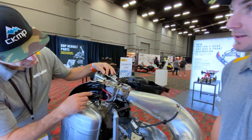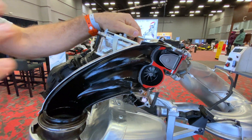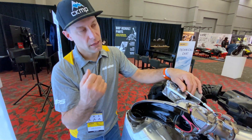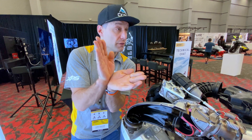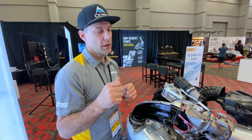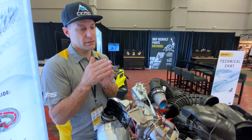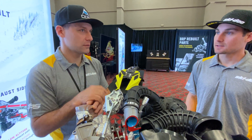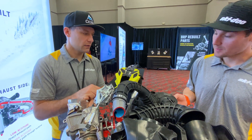Tell me about the wastegate — why is it the shape that it is? If you look in here, the shape of the wastegate is an important part. Because it's triangulated rather than just a round wastegate, it doesn't just dump all the pressure at once — it's progressive. When it opens at the point it just lets a little bit out, and if it really needs to dump it opens up for big volume. That's why at partial mid-throttle you hear it go — the wastegate is opening in small increments, not all-or-nothing, just what's needed.